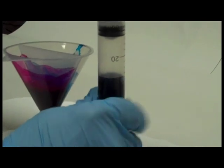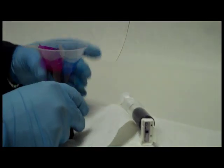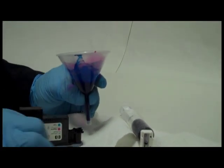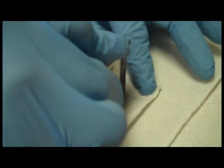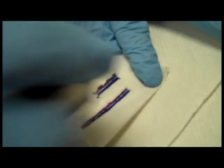Step 5: when you notice that the ink coming out of the printhead is clean and free of air bubbles, you can stop pulling and remove the tool, rinsing it with water for future use. Wipe the printhead off with a slightly damp paper towel, then press it against a clean and dry paper towel. A solid pattern like this one should appear. At this point, the weight of the printhead should be 60 grams, but anything above 57 will be fine.